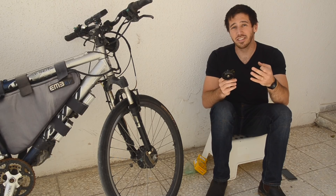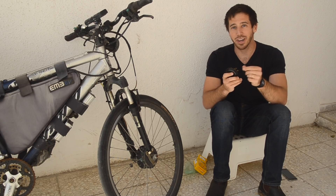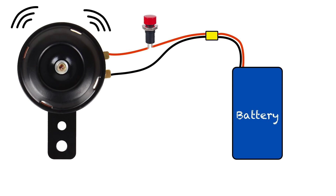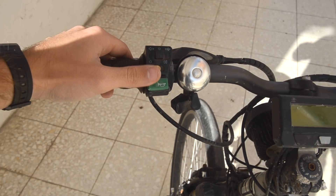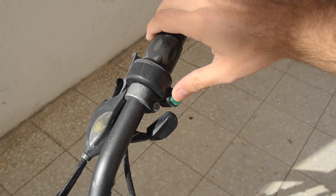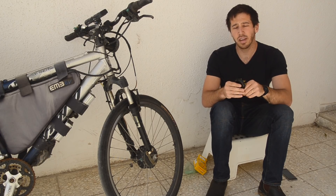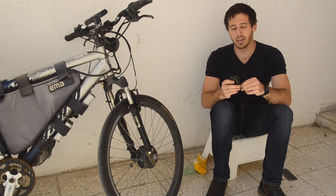You're probably wondering: do I need to connect this directly to my battery? The better way to do this is to use a switch so you don't have to connect and disconnect it each time. The important thing is to use a momentary contact switch — that's the type that only functions when you push it. On my e-bike, I've got a nice switch on my handlebars with a momentary contact for a horn and some other switches for lights. If you have a throttle with a green button on it, that's probably a momentary contact switch. The red ones are usually on-off switches. I'll put a link in the description to switches like this one — they're also cheap, just a few dollars.